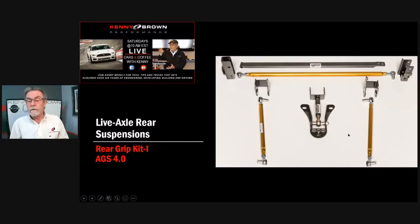And the other little trick that I do is the control arms on a 197 are splayed outward at the front. So what we do is I've got bushings, so we take and we move the front part in and the back part out. So now we've got lower control arms parallel to the center line of the car, which all race cars have. If you look at a stock one from the top in plan view, and you were to draw a line back where the two lower control arms intersect, it'd be well behind the car. And if you take that point and draw a line from that point up through the roll center, the factory roll center is up high, then your roll axis is pointing up in the back, and that's not what we're looking for.